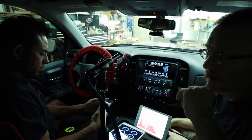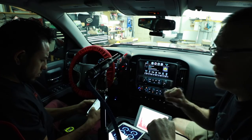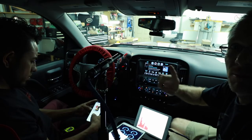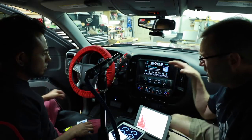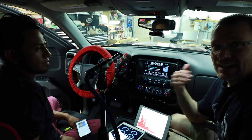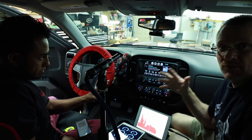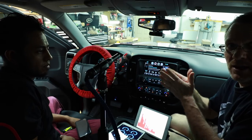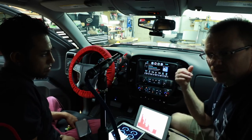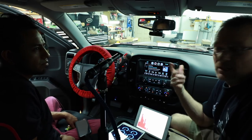We've been playing this thing for a really long time now, getting the EQ about where we wanted it. The main concern was the FM. If you have this 8-inch touchscreen non-Bose, the FM is going to be a compromise — but it really doesn't sound bad. Because we're using the DSR-1, we get to EQ it. It's not stereo anymore, it's not mono — it's a dual left or dual right channel being cloned, and only on FM, AM, and Sirius XM. Everything else plays normal stereo. Because we're using DSP and able to EQ it a lot, it sounds good. You can even hear it and think, 'wow' — I don't think anyone would suffer from this.